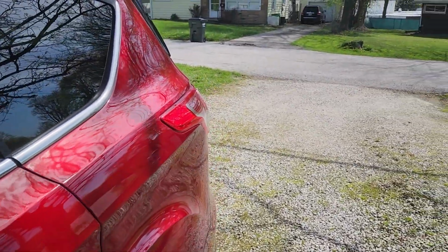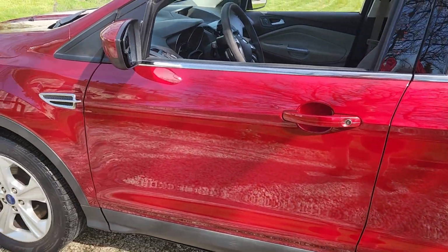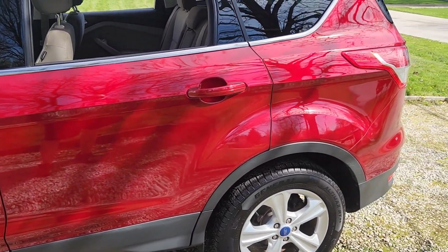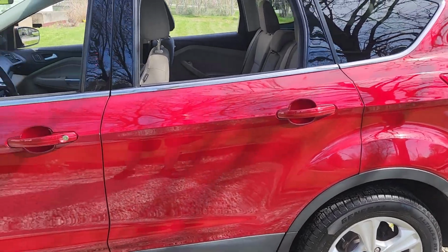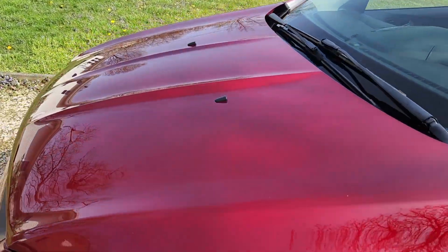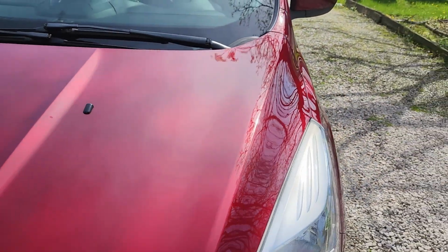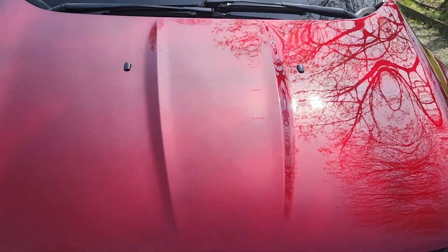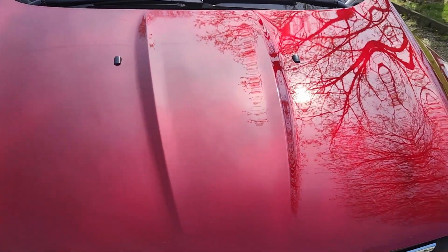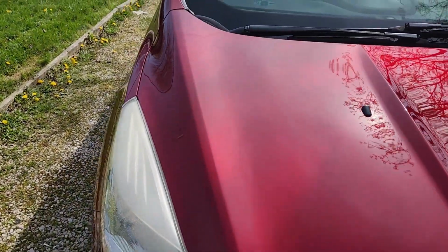So you can see, like I said before, if you think your wax, sealant, or coating is dying off, check the environment the car's in. As I showed in this video, the coating was still going very strong, just the properties were being masked by all the tree sap that landed on the car from the rains. Clean that off using the all-purpose cleaner, 2 cups to 2 gallons of water. Use the pressure sprayer or pump sprayer that's been converted to accept a tire valve basically and be pumped up that way with my air compressor. Makes for a whole lot easier working with it.